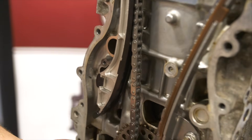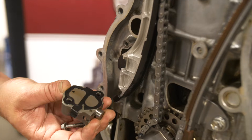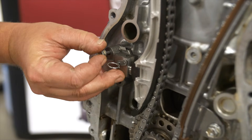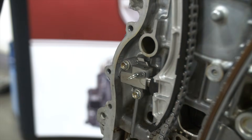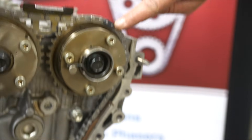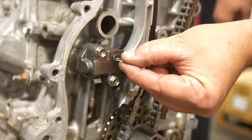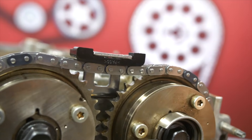Then, after ensuring the gasket surface is clean, install the timing chain tensioner with the gasket provided. Repeat the process from the last step to shift all the chain slack. Check the three timing marks once more, then pull the tensioner activation pin. Make sure that the tensioner is activated by checking for tensioner extension when pivoting the tensioner guide. You may notice a small amount of overlap chain slack by the top guide while actuating the tensioner — this is normal.